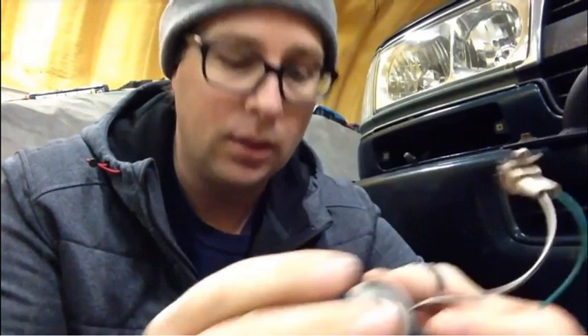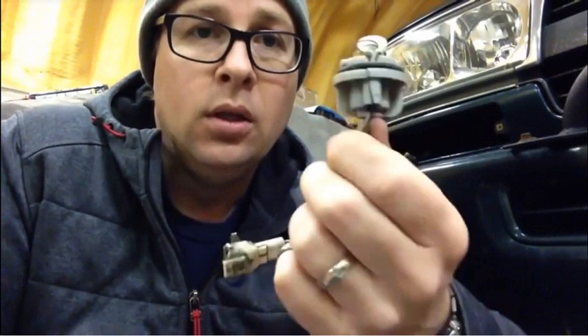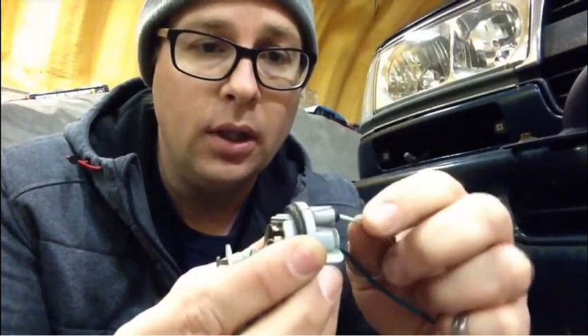So the next thing is the outside of the socket — I just tested the center pin, now I'm going to test the outside. I know that should be connected to the black-white wire because the center is connected to green. It's not blowing a fuse, so it shouldn't be connected to green as well, but we'll check both. I'm holding the probe against the outside of the connector. I should get a tone on the black-white wire and not the green. Nothing on green — and I get nothing on black-white. So I've narrowed it down further; the problem is something on the black-white wire. It could be a broken wire, a bad connection in the pin, or a bad connection to the socket. And looking at this — I don't know if you can see that — but there's a big crack down the side, which points me pretty suspect in the direction that that's where the problem lies.